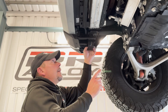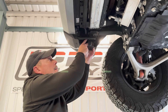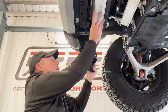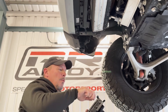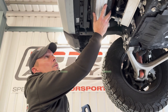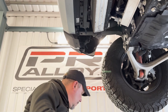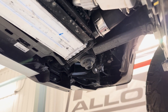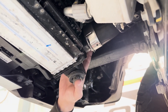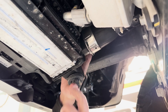As per the other side, this is now the driver side we're working on. I've done exactly the same — undone the same bolts, pulled it off. The bracket comes down; we'll bend the tab on this one as we did on the opposite side. The intercooler now is just hanging on the hoses — that's all you need to do. All of the boost hoses on the pipework here are retained onto the spigots with a simple wire clip.